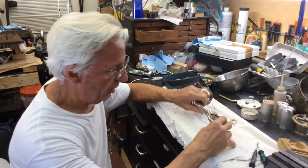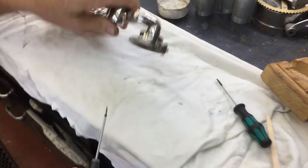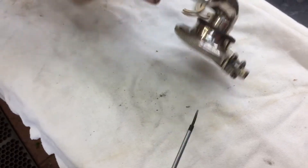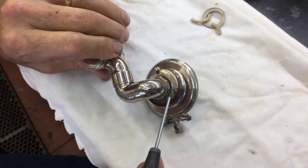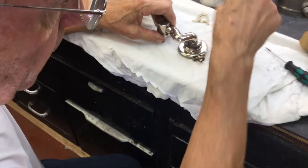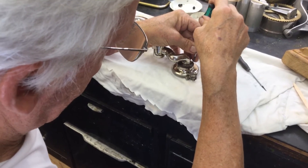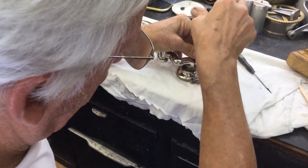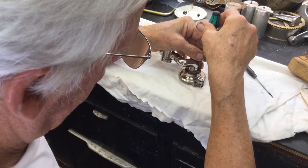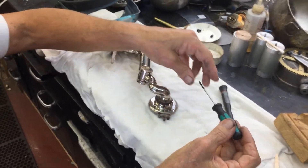Off-camera I've done a few things. I've taken the screw out of the needle bar. But these right here, you can see that the mica is cracked. So to get it off, you have three screws — one here, one there, one there. We'll take this one out. I always use a magnetic screwdriver on these; I don't want to lose these little screws.